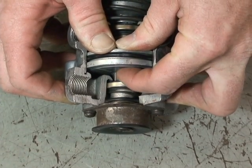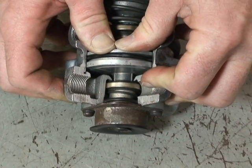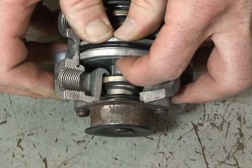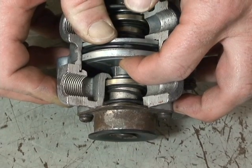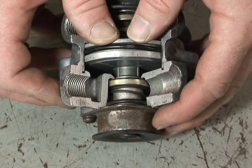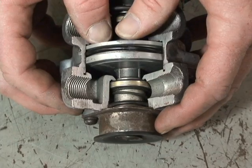The engineers have designed the springs and surface area in here so that if there's 10 psi of force being exerted in the valve, then as soon as you get 10 psi on the bottom of the relay piston, it balances. It then closes the supply port to the tank and goes into a hold cycle, supplying 10 psi to your service brakes.